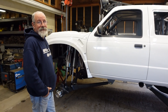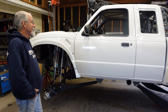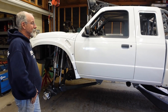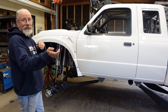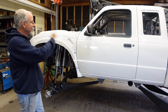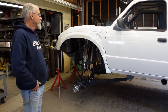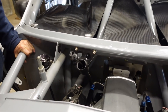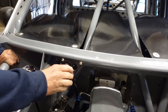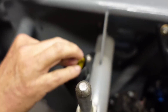Through his racing experience, every something bad that happened during a race, he tried to fix the problems. For example, the fuel system — Brian and he raced one race and the whole fuel system clogged up. So this thing has two complete fuel systems, left and right. You just switch a switch to the other side and it gets fuel to the front. Everything's upside-down valves — the dipstick, the filler — you can be upside down and no fluid leaks out of this truck. So if you're ever on your side, the dipstick never seals and fluid can leak on the exhaust and catch fire. With these sealed systems, engine oil is the same — if you roll over you're not leaking fluids everywhere and not losing fluid either.